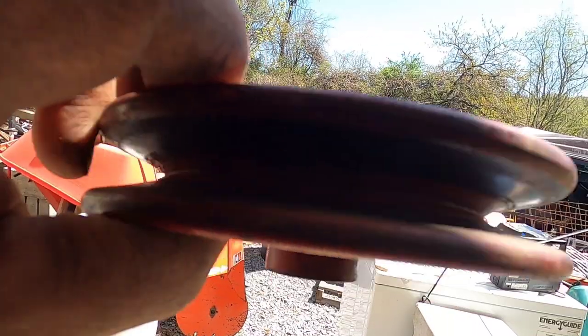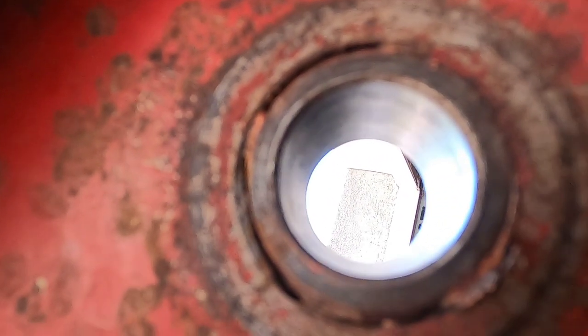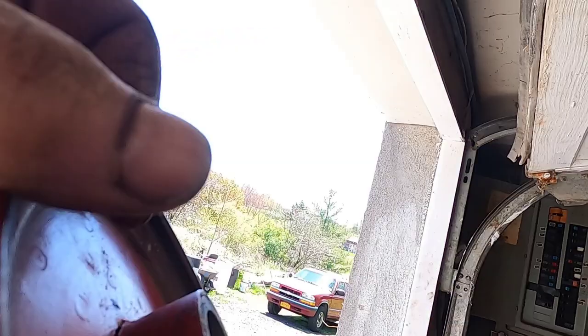Okay, I'm holding the camera and holding this pulley. This is the pulley that was good. I noticed when I spun the pulley it had a little bit of a wobble to it, and now I see why — this pulley is pulling apart right here. This is just from wear because we didn't have to do anything to get this pulley off; it just came right off. You can see over here where it's coming apart, right around this edge. On the bottom part you can see it's pulling away. So I'm going to tap this a little bit to get it straight and then tack weld it — get a couple of tacks right around here with the welder.